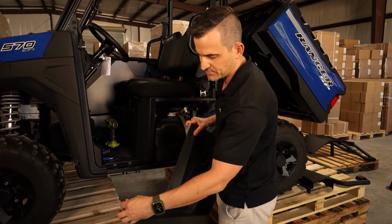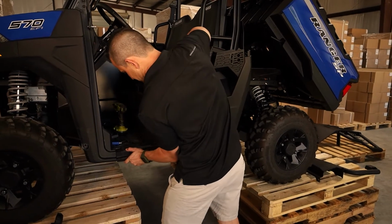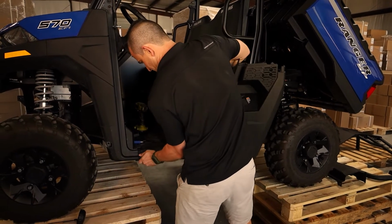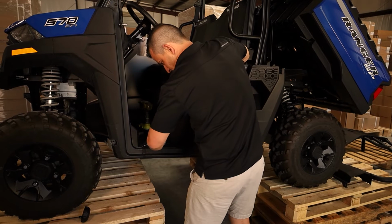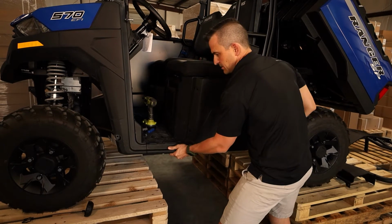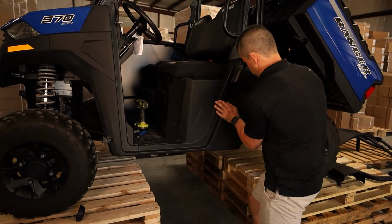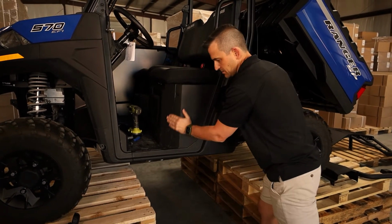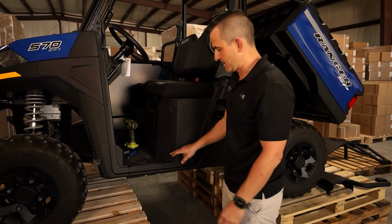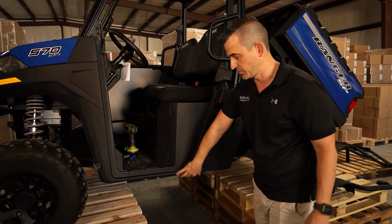The trickiest part here, and sometimes it gives me some hassles, is getting this back underneath this panel here, because it's quite hard plastic. With that speed nut on there, it wants to grip. But once you get underneath it started, it's a piece of cake. Give it a bang in, lift it up over your fuel spout. Okay, all good, that's in now. So you can go ahead now and replace all your plastic pins if you want, or you can wait until you've got the rest of it put on.